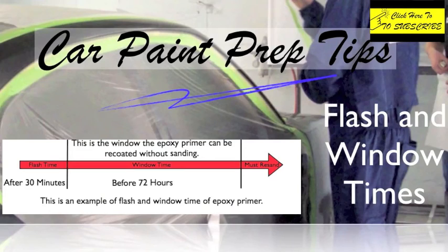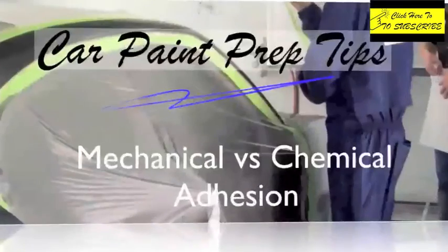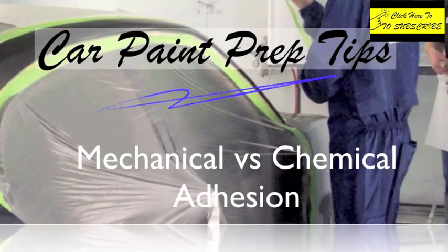So let's check the P pages on that. Mechanical versus chemical adhesion. Well, we've talked a lot about mechanical adhesion. That provides that tooth, that roughs up the paint so that the paint has something to stick to. And the chemical adhesion is done chemically. That's where two chemicals still bond together without the scratches, without that tooth to bite to.